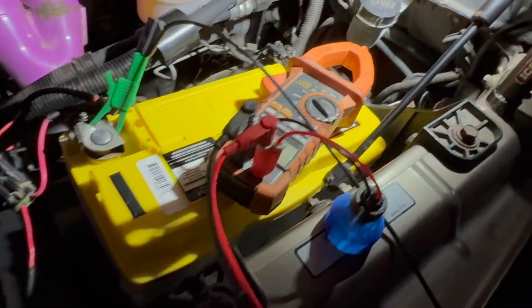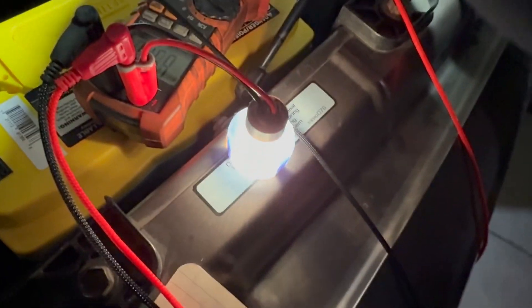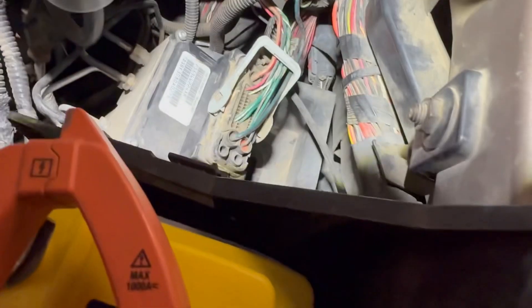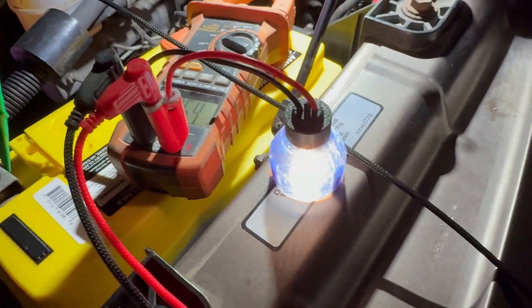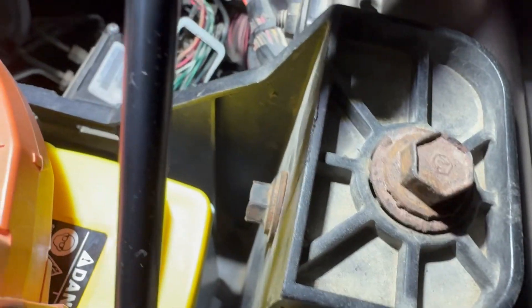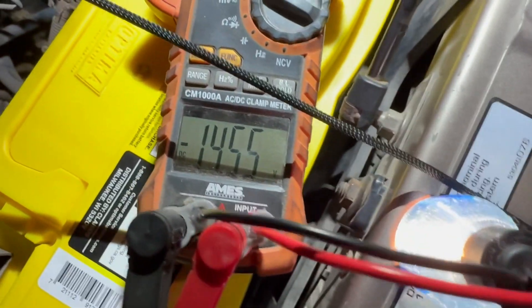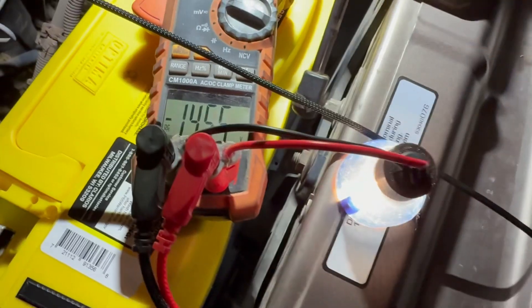That was weird — felt like I got shocked there. Okay, so now switching the lead over to positive, you can see it lights up backwards. Now testing the grounds — we got that big fat black dark green, and then another black dark green, one's fatter than the other. We got a good ground — you can see that light — and we got charging voltage. Testing the other one — I can see that light up right away. So with this down, we've got no power.